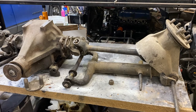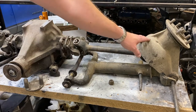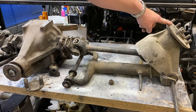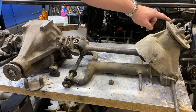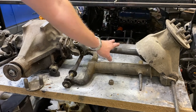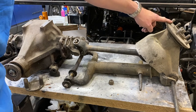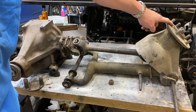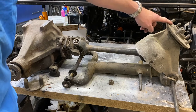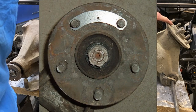Maintenance is not that hard, and you can easily work on a unit like this. Here on the other end, we have the upright — this is an aluminum casting. You've got the hub assembly, and there's a U-joint inside this part that connects the stub axle to the half shaft. The bolt pattern on this is five on four and three quarters, which is a typical Chevy bolt pattern. But there's a lot of meat here; on my project I wanted a five on four and a half.